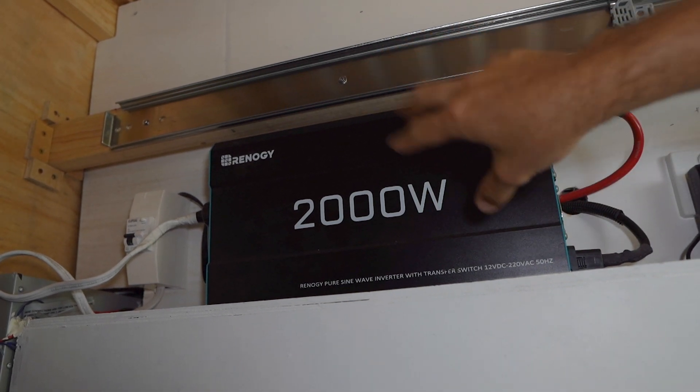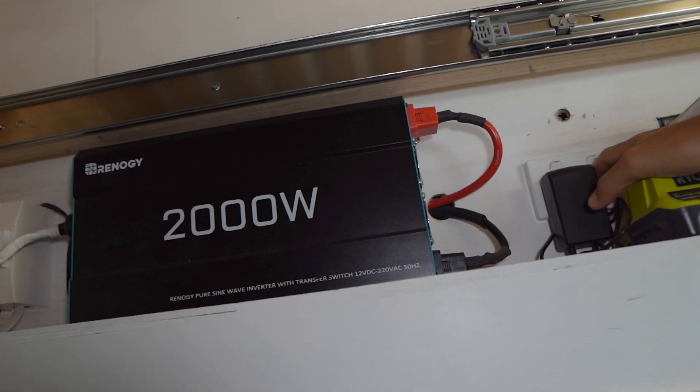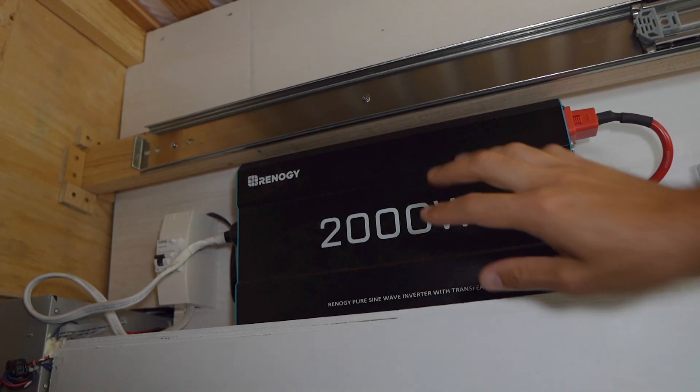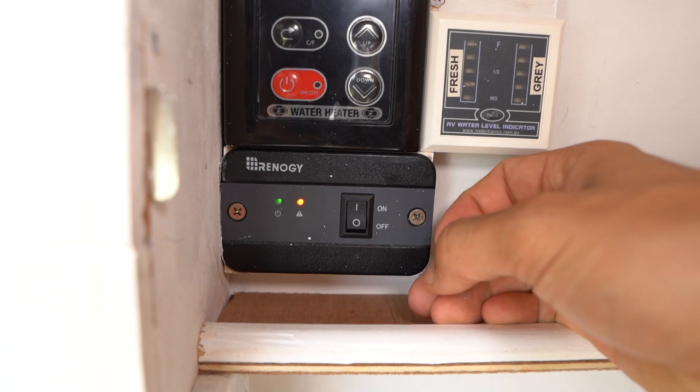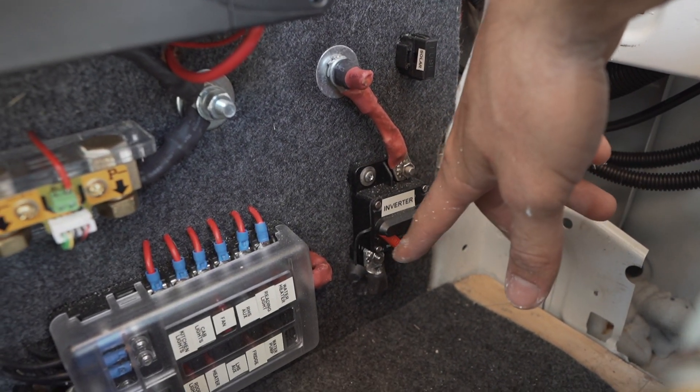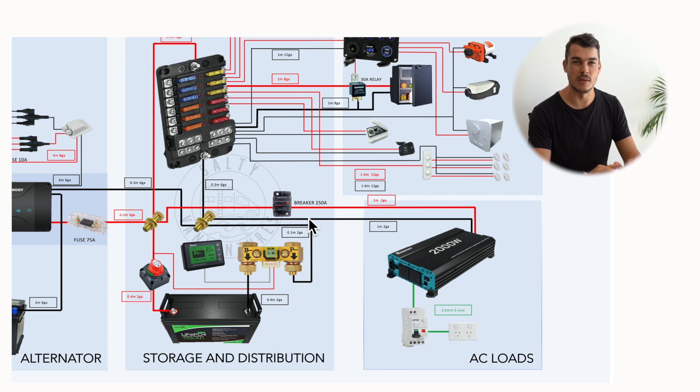Under the bed here is where the 2000 watt inverter is located. There's a power point here, and that's also the circuit breaker — wired in by an electrician. This is turned on and off with a remote switch in the cabin, so we don't have to come down here. You want to make sure these wires are as short as possible because they run a very high current — this 2000 watt inverter at 12 volts runs about 160 amps. I also included an inline resettable breaker because I didn't want to use an expensive 250 amp fuse. I've only had it trip once when I put way too much load through the inverter at one time, but it was far better than burning out my wires or potentially hurting the inverter or my battery.